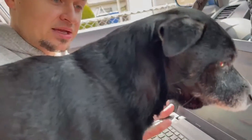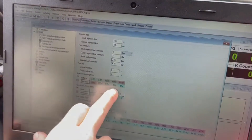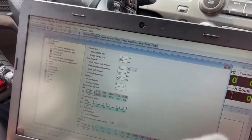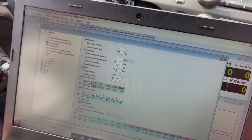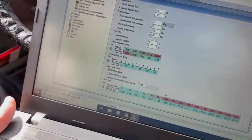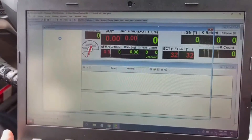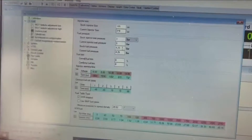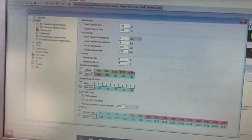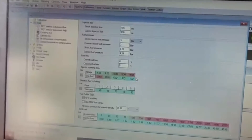We're here in the car with Hondata pulled up, and we got our dog here managing the tune. Right now you can see the factory calibration here: 185cc injectors and these are the injector dead times. What we're going to have to do is swap this out to 310cc — there's already a built-in calibration. You're also going to have to change the injector dead times. Under calibration, go under fuel — we went from 185 to 310cc at three bar of pressure. These are the 310cc Honda Civic SI injector dead times, so make sure you have the right dead time so your fueling is appropriate and proper.